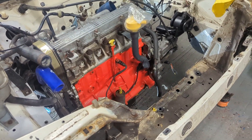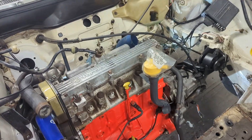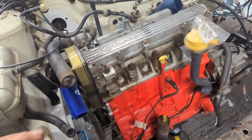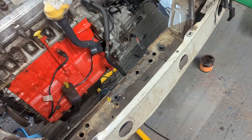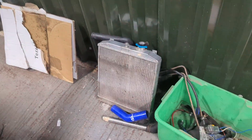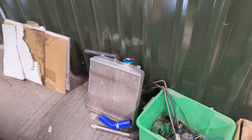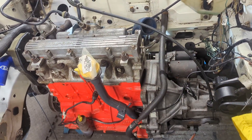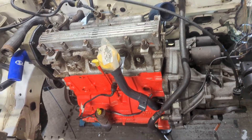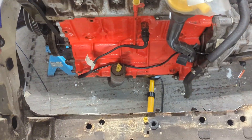I've had a look at some of the cooling situations and I've got a rough map of where that's going to go. It's pretty straightforward — obviously in and out the engine, so the water pump and the thermostat, and then it just has to go to the heaters, which is what that shiny pipe at the back does. I'm going to reuse the Honda Civic radiator. I've just got to tee that into the bottom of the radiator here and then tee that in here somewhere.